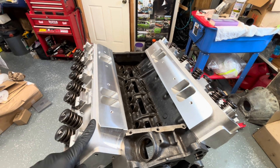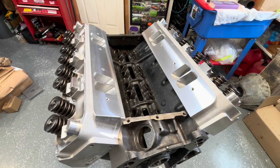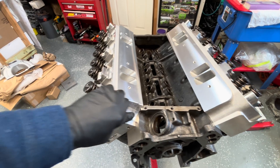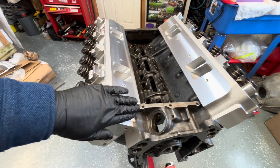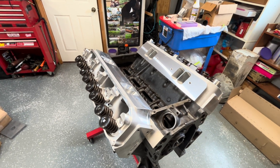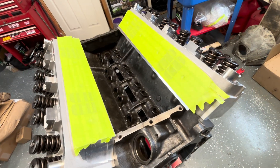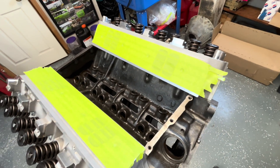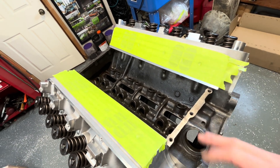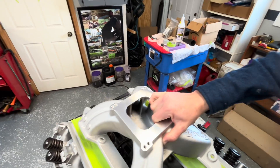These are 270s, we do have the 240s. I'll go with whatever the owner wants. Obviously there are different reasons for buying different heads. You'll notice I already like how they've got this cut out for a distributor, so you don't have to grind it out yourself. That's cool. I want to show you how the Track Heat intake fits on these heads just as it is right now. Let me get it taped up. I've got some masking tape laid out over the ports and covering the entire edge of the head. That'll be a quick transfer for us in just a second. And here is our Trick Flow Track Heat intake.